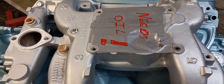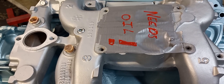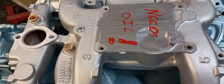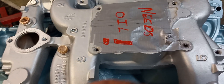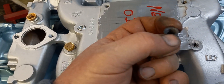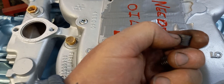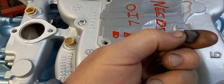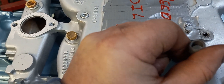I thought I could get in there and break it off, but I didn't feel that lucky. I found it later on — I guess that's the excuse I'm going to use. So what I did is I installed a TimeSert. The thread pitch is the same. The only difference is that the TimeSert has to be sunk down a little bit for that little top hat to register. There's no tang or anything for it to fall out.